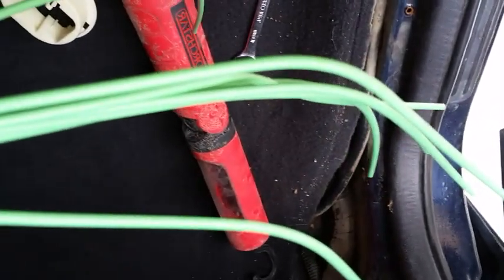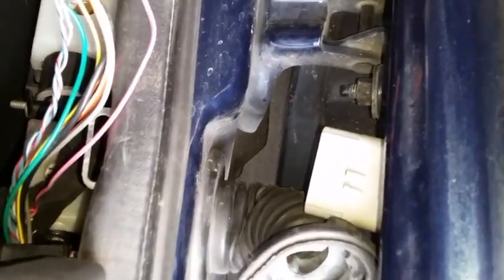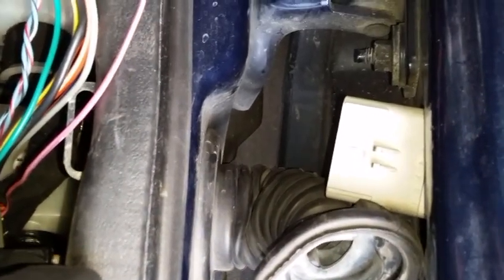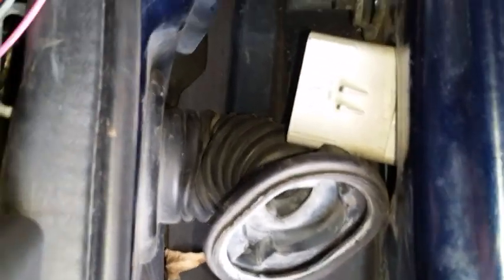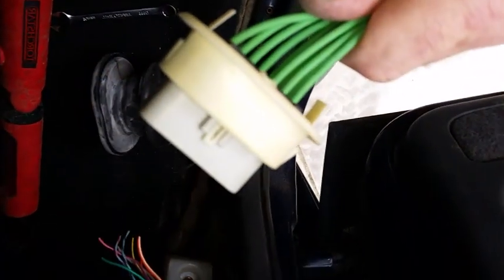Actually, before I do what I just said about the stripping, it's good to put, you could do it after the stripping, but I did it on the driver's side before, get these 10 wires through that boot that was there, up to that point. Now, that is not going to work out too easy if you leave the boot in place. I guess it could be done, but it's just too much. So what I'm going to do to make it easier is just pull this boot out completely, and then be able to straighten it out and push these wires through. I'll show you how to do that. It's not that hard. I just couldn't do it,